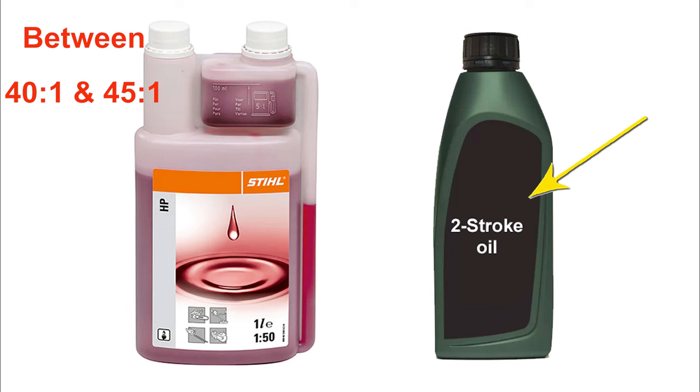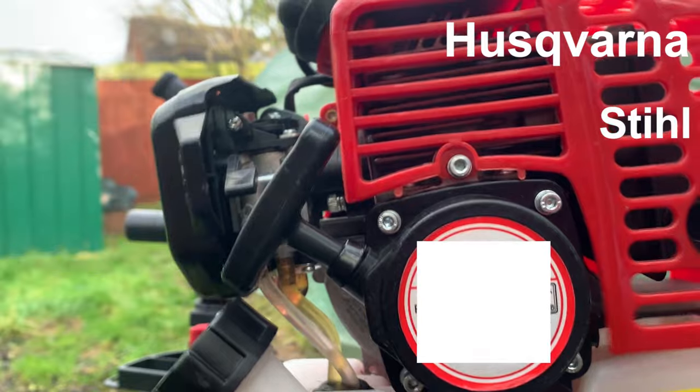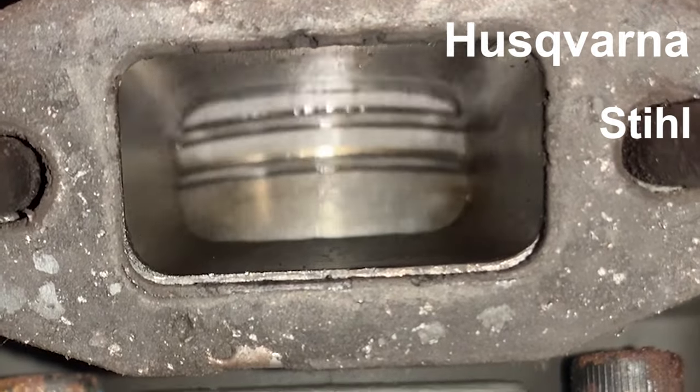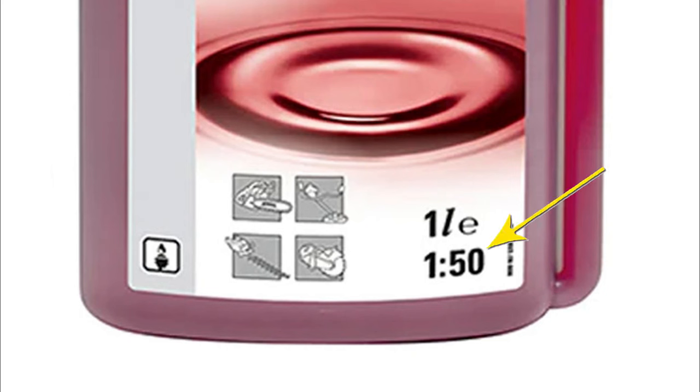So if we're using an aftermarket type oil that we don't know the name of, then I personally would go for something like 25 to 30 to 1, especially on something like this. But if I was to use a Husqvarna or a Stihl — something with more quality — then the tolerances in there are going to be different, the components are going to be different inside. And if we use the oils recommended by the manufacturer, such as this Stihl 50 to 1 oil that's specially designed to be used at that strength because it has far more superior ingredients, then that's the way to go.